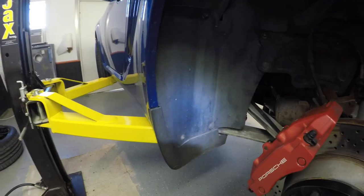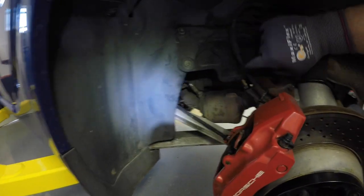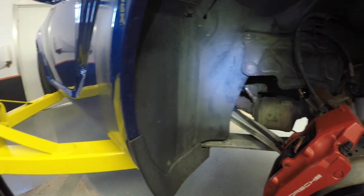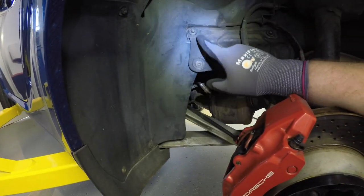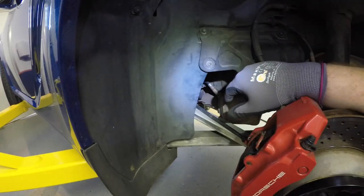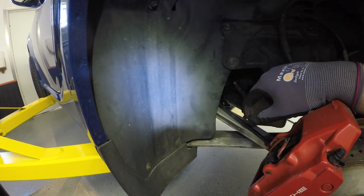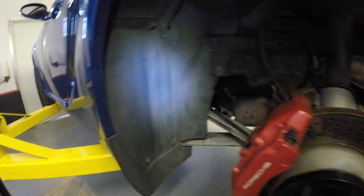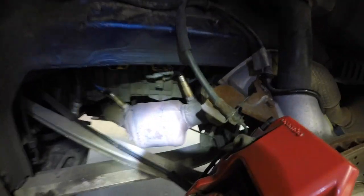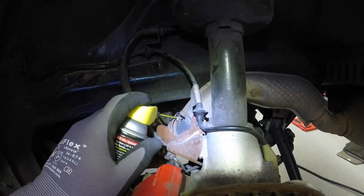Here's that big spacer. So there are two things that are kind of common on the inside of this wheel well. We have to remove this black piece of plastic here, and this black piece of plastic here. All of this is held in with number 10s and T25 Torx — pretty easy to take off if you have a pneumatic or battery-operated wrench. If not, you can use hand tools; they're not on there relatively tight. One of the things I'm going to do while I work on the other side is soak this through with some penetrating oil now, so when I come back, hopefully it's good to go.